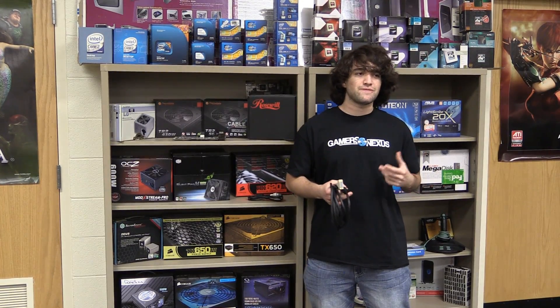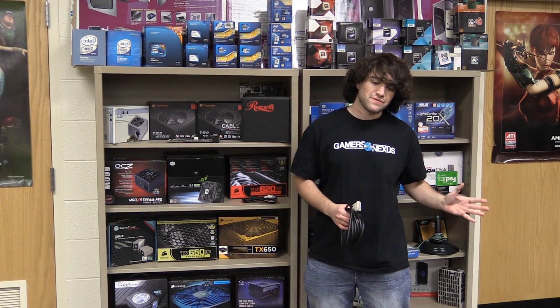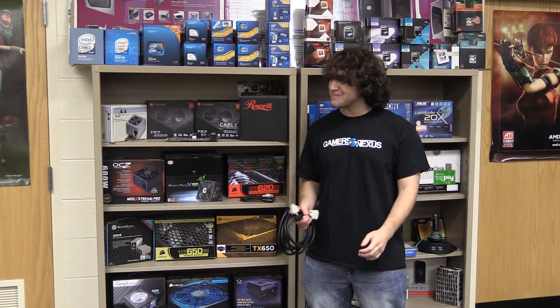While we're on the note of cables, I want to mention SATA 2 versus SATA 3. There are a lot of fallacies out there — a lot of people on the internet, on message boards, on whatever website, say you're not going to get full speeds if you buy a SATA 2 cable with your SSD. That's not true. They work at the same speed. SATA 2 versus SATA 3 cables are identical in terms of their throughput, other than the little clip at the top. So if you really like that little clippy thing and you like the noise it makes, then buy a SATA 3 cable, but otherwise don't worry about it. It's the same speed.